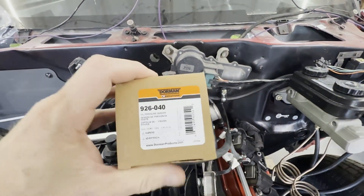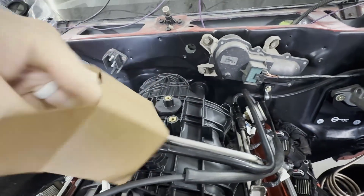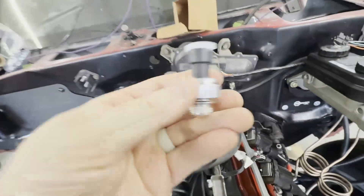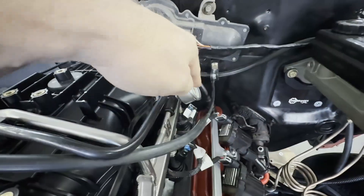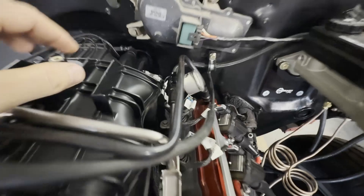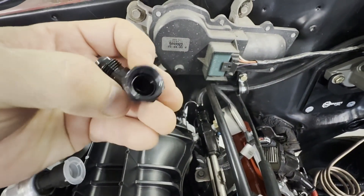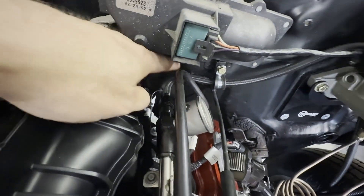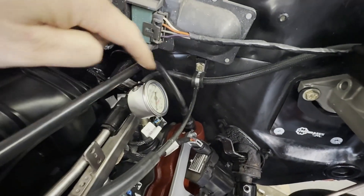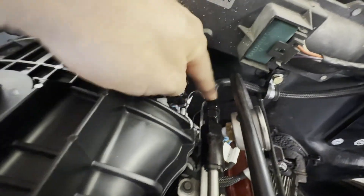So I went to the parts store — this is the only one they had. I couldn't find the AC Delco, but I got the Dorman; they had it in stock. If I was going to order it I would have ordered the AC Delco, but I'm going to put the stock oil pressure sending unit back in and use the one that was supplied with the ACES kit so I can see it inside on the dash. I've got a straight fitting on here, and I've ordered a 90-degree AN6 on one side and AN6 female on the other. My hope is it's going to kick this out enough that it bends around the PCV line so I have enough room to put my fitting in here and I don't have to change this over to a 90.